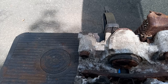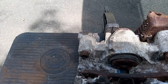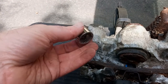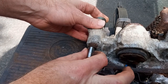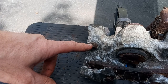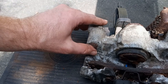Now that I've removed the dust boot, what we need to do is push this caliper slide through. The easiest way I've found requires a couple of sockets — not to turn anything, but to use them as a method of pushing. We use a large socket, bigger than the caliper slide, and a smaller socket on the end to push it through. What happens is these get so rusted that the corrosion literally fuses to the rubber rings on either side, and you can't even push this through.